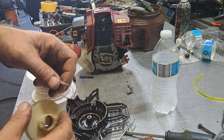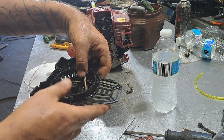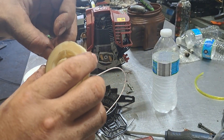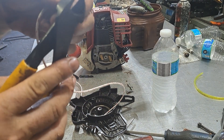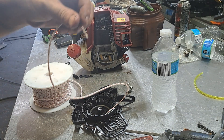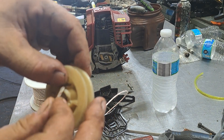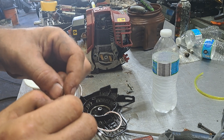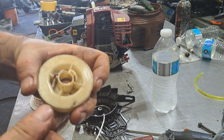There's a washer that goes on top of this — be careful you don't lose it. We're going to go through the recoil itself first, then through the pulley. We've got to get this more to a point; it's got a knot on it. So you see there's like a little slot right here — it goes through like that. We're going to tie a simple knot and then put this through that slot, pull it down in, throw that simple knot in that slot right there, like that.